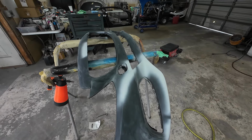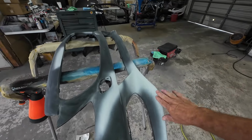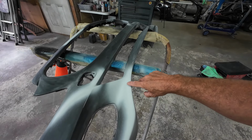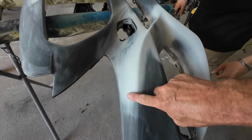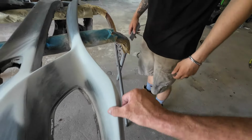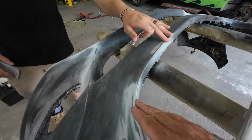He's got this all sanded, 320, primer those areas that he feather edged out, and we're gonna fill those next after this dries. Now, before we fill it, we're gonna sand it with a little bit of 180 on the areas that we're gonna fill. Darius has got this primer pretty much sanded. He went over it with 320 grit sandpaper, smoothed it all out, smoothed out the texture. We're looking for any imperfections that we need to fill. So I'm going to go around and fill those imperfections while he finishes sanding.